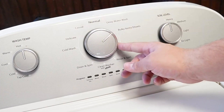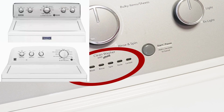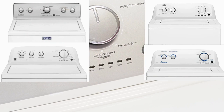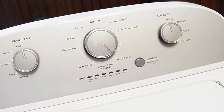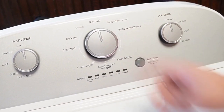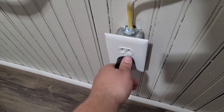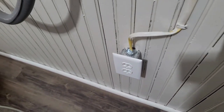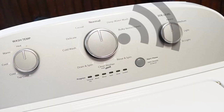Note that these steps will work for all washing machines that have these oval LED segments just below the washer dial, and that includes Whirlpool, Maytag, Kenmore, Roper, Amana, Admiral, and Crossley brand washers. We can do the first two resets in sequence. First, rotate your washer's control dial counterclockwise until it's at the north or 12 o'clock position. Once that's done, unplug the washing machine from the wall, and with the unit unplugged, wait about a minute before you plug the power cord back in. You should hear a faint clicking noise from the back of the washer relay as it boots up.